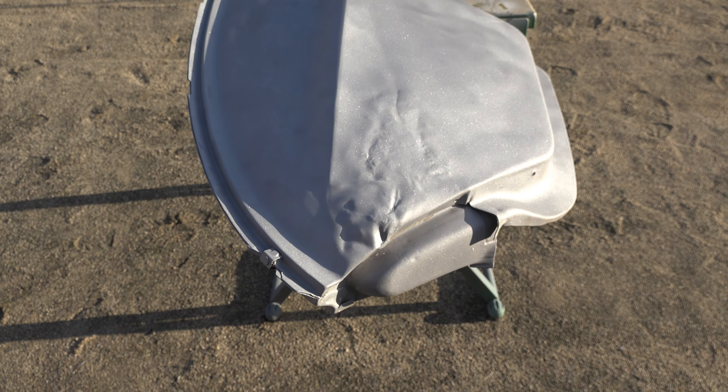With all the paint and Bondo gone, all that's left to do now is bodywork. I first set my sights on the large dent on the front of the driver side fender. This spot still needed a lot of help, so I began working this dent out to the best of my abilities with the hammer and dolly. After a lot of hammering and dollying, I want to begin test fitting this fender back onto the car to see how everything looks. Before that, I want to work out this damage on the body that occurred behind the fender. Some vice grips and the hammer and dolly make this damage disappear in no time, and with this area now fixed, I can place the fender back onto the car.